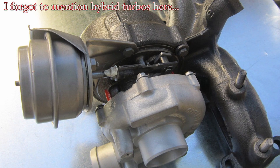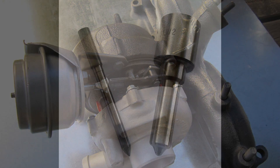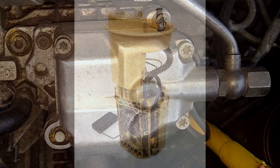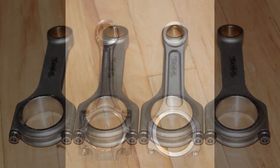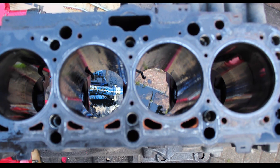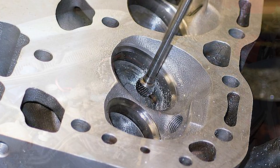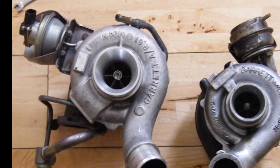What would I look at next? Bigger parts and custom engine internals. I'd be looking at a bigger turbo, bigger nozzles, a beefier clutch capable of over 300 foot-pound of torque. I'd also look at the fuel pump — going bigger than the stock 10mm pump to an 11mm pump — and an in-tank lift pump. On the internals side I'd look at stronger conrods, new pistons, potentially boring the engine slightly for the best fit, and custom cams along with porting the inlet and outlet manifolds. With this engine, that would put you in the region of about 250 brake horsepower.